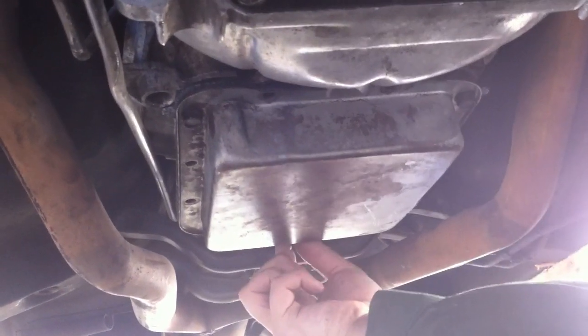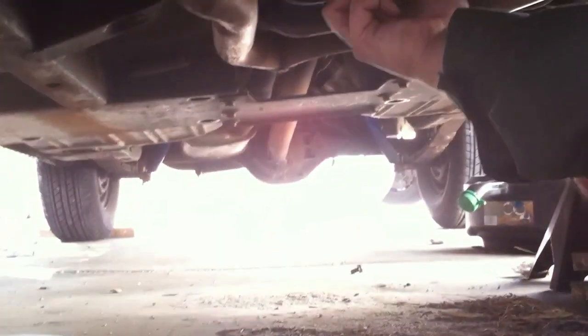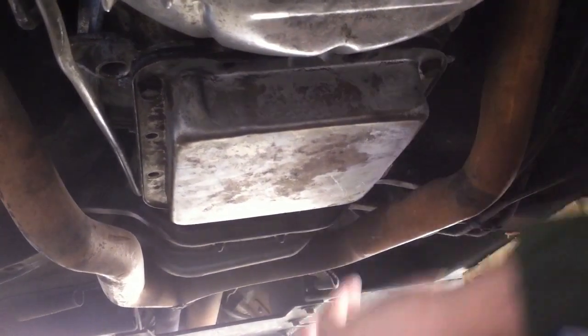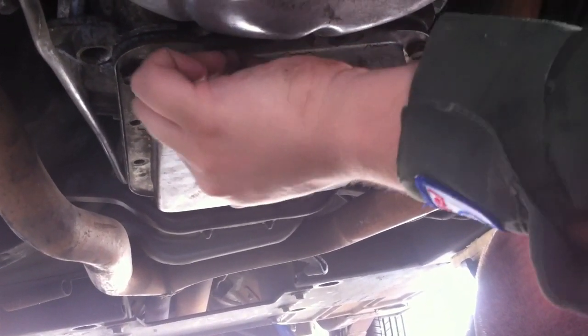Another bolt dropped — there's so much dirt in there from the sand that blows around this town. Drive shaft's in place, exhaust manifolds are connected, trans mount is nice and pretty — remember how gunked up that thing was. Here's the trans pan being secured. We're going to snug it up, starting from opposite sides, very gently, like we always do with trans pans. Here's more detail of the underside — there's the heat plate we painted silver, and the exhaust manifolds.